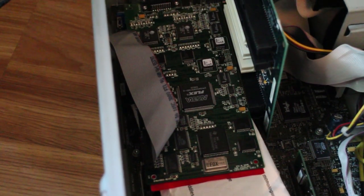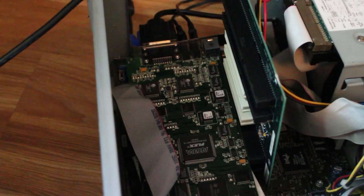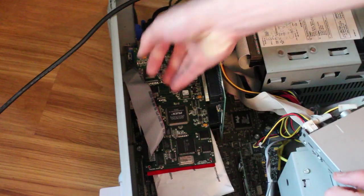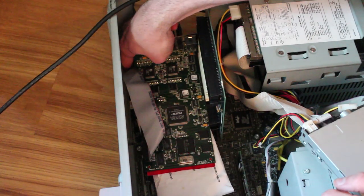The VFX1 comes with an ISA card, which is a really old standard that computers don't use anymore. So my friend actually brought over his old Compaq Presario. It's a 200 MHz computer with 32 MB of RAM. This thing's really old, but it had the ISA slot, and that's what we needed. So you plug the card into the ISA slot, and then it has what's called a VESA connector, V-E-S-A. The VESA connector plugs in from the ISA card to your onboard graphics card.